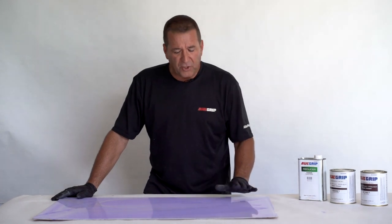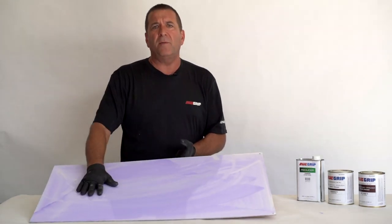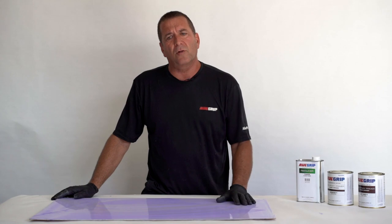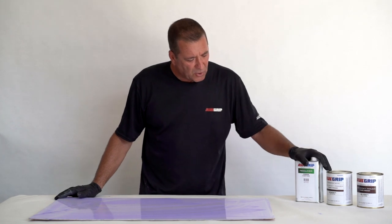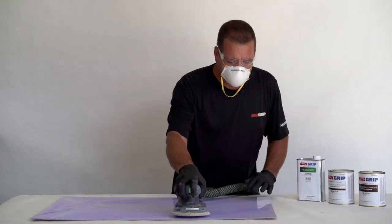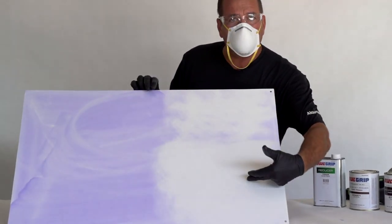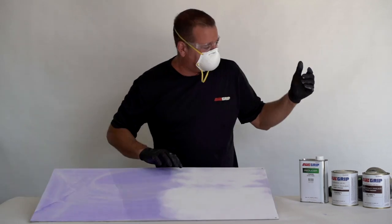Now that we've cleaned our gel-coated panel, we've applied some guide coat. Guide coat is basically a thin sacrificial film that you put down — whether it's a spray can or different versions — it just shows your highs and lows and shows you that you're thoroughly sanded. So we're going to prepare this panel to prime with 545 epoxy primer using 180 grit sandpaper on a DA. You can see where I've sanded thoroughly there's no guide coat left, but where there are little bits and patches of guide coat still there, that tells you there's more sanding to be done.